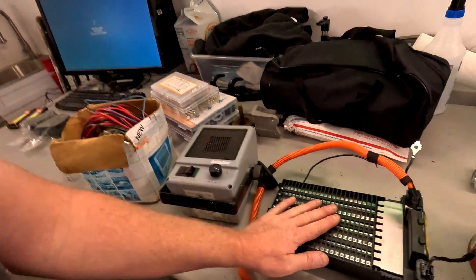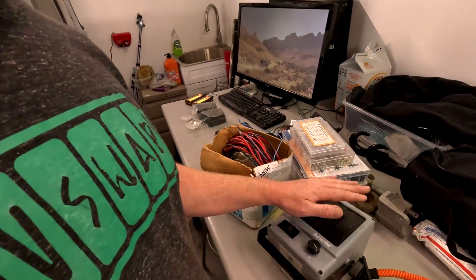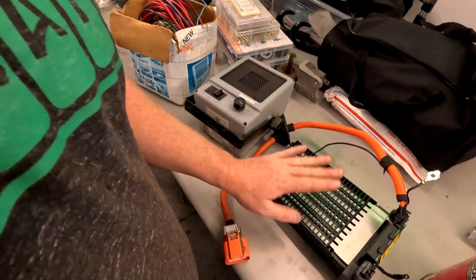This PTC heater can do 5,000 watts. One issue with it is that it pulls tons of power — 5,000 watts is a lot, and if you have it running constantly it's going to drain your battery considerably versus just when you're driving. So you have to be really judicious with your use of this heater. Maybe we'll insert a timer so that it cycles on and off automatically. But thinking about Dave — he lives up in the mountains, and when it's 20 degrees out and he climbs into his pickup truck, 300 watts is nothing. It won't even defrost the windshield. So we're going to have to replace the heater core in the truck with this electric heating element.